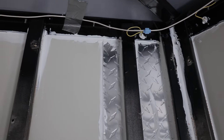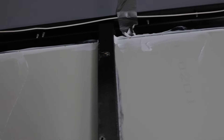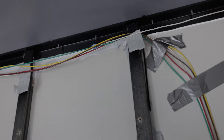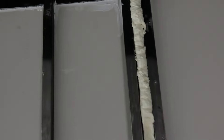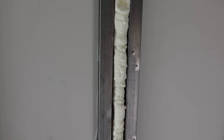Check it out guys — we've got everything sealed up. Ran a small bead of caulk around the top of the trailer. I know this isn't a hundred percent, but it's better than what it was. As long as it serves its purpose — we're just trying to seal everything up that could potentially leak. It rained today and I didn't see any leaks nowhere in the trailer, which is good. We'll double check right before we get ready to put this insulation in. These wires are just temporarily taped up and we're going to get them zip tied out of the way. One thing to watch for is where your trailer lights are drilled through the trailer — make sure to caulk those up best you can. You don't want a ton of caulk or silicone in the hole; a little bit of foam spray on these narrow pieces and we'll get that trimmed up.